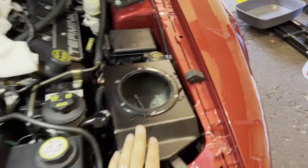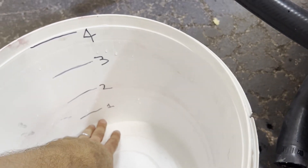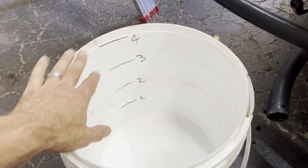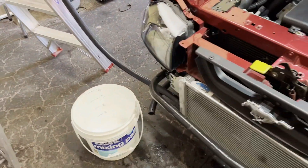I'm about ready to start flow testing. The reservoir is filled with water — it goes straight down into the EMP pump, through the flow sensor, up into the intercooler, into the heat exchanger, and out into a bucket. I went ahead and marked graduated gallon marks in the bucket. We'll ignore the first gallon while the pump ramps up to speed, then time how long it takes to pass each mark. I'm shooting at 30 frames per second so I can open the raw footage, count frames, and calculate exact flow rate. We'll also feed the data into the MS3 to equate pulses to actual gallons per minute.